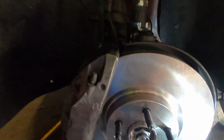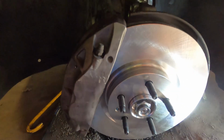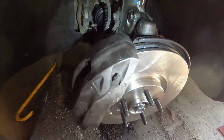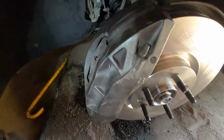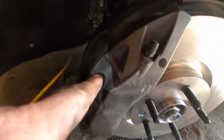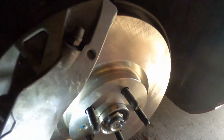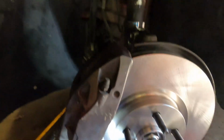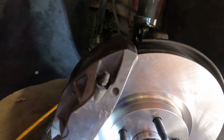All right, here for the brake pad video. You'll see this rotor is already brand new. I'll show the disassembly. I'm gonna have to cut this in kind of a weird way because I did a new hub, rotor, axle, and everything else. I've already had this caliper off, but to actually start this, I want the caliper mounted on, and we're gonna hammer out these two little pins here. I don't know if you can see them. So one there and one there, and that holds the whole brake pad assembly together in there. So we're gonna try and tap these out, and then we'll pull the brake caliper off, and the brake pads will just stay, and we'll try and fish the new ones in and hammer in the new pins and see what we can do.